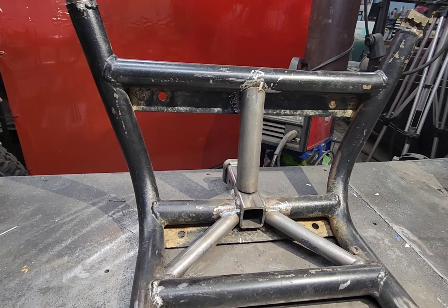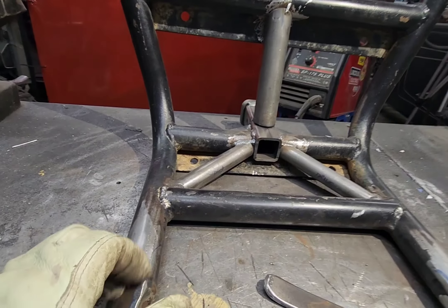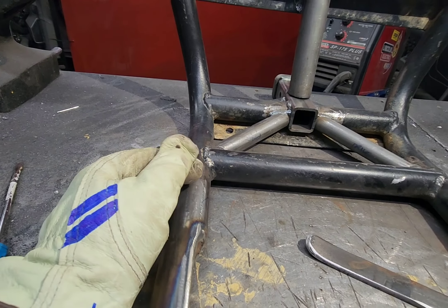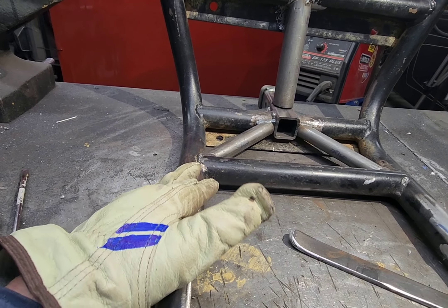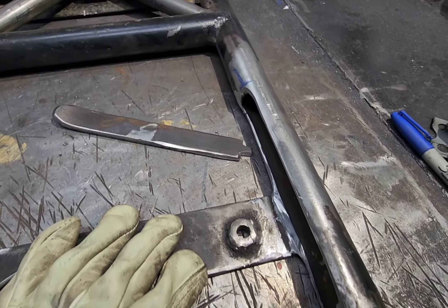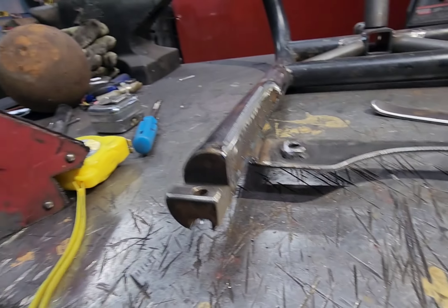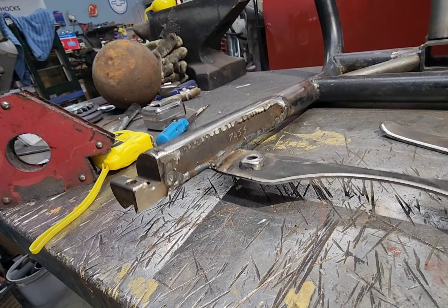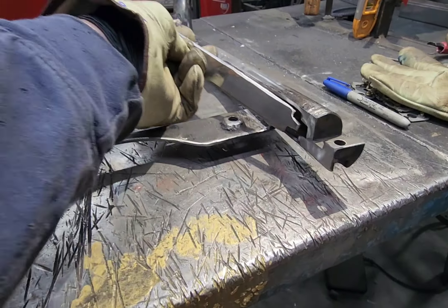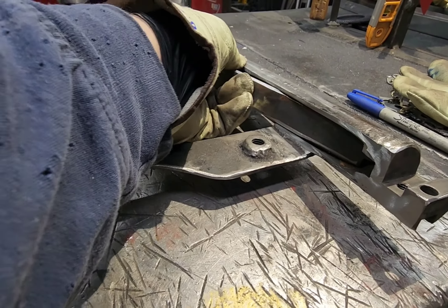I'm working on my rear skid plate — there's the hitch, I've got to weld that in a little bit more. When I had this mocked up, the motor was on each side of this, it was only about a quarter inch, so I wanted to gain a little extra space. This was originally made for a Vortec 4 cylinder, so I decided to notch about a half an inch out of the side of the tube. This side I've already started to fill in. I'll do the same thing for the part that connects to the chassis, just put an eighth plate in there to fill it back in.